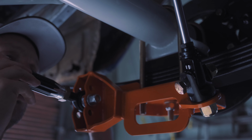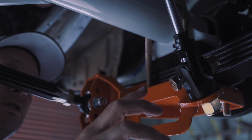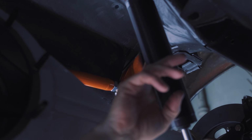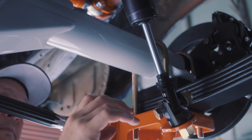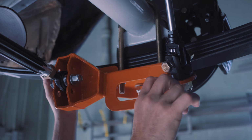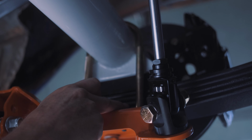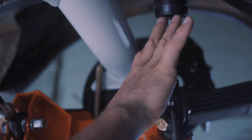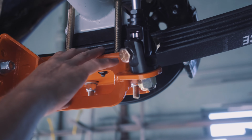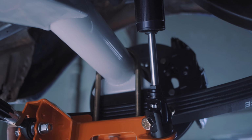But so when you order the Meyer Racing rear suspension kit, essentially you have three options. You have the Bilstein shock, the upgraded Integra shock steel body, or the single adjust aluminum body Integra. And here's the adjuster here. In the Integra options, you have to run a clevis. The downside to the clevis is it shortens up the distance and shortens up some travel. So you just have to tune into that. With a Meyer Racing lowered spring and a 1-inch block, I believe you're fine as far as travel goes. But we just need to double check that. So if you're going with the 1-inch block, just tune into the travel here. We can talk about that more later.